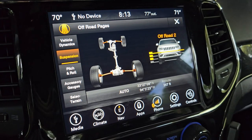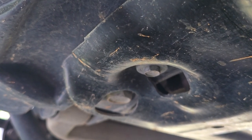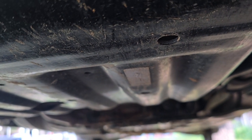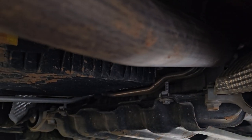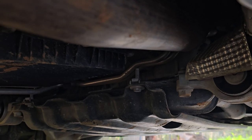That should make it a little bit easier getting the skid plate off and getting to the front differential. We've got a half-inch bolt here and back here, probably two in the back. This one is actually missing one — I need to find one and put it in. There's a slot here so these will loosen and slide forward. Let's get this dropped so we can access that differential easier. You can see the two half-inch bolts going up to the back of the plate — we're gonna loosen those and that plate will just drop right out.